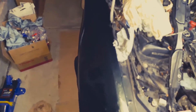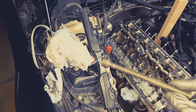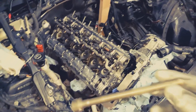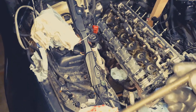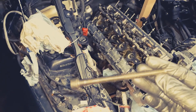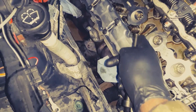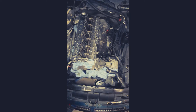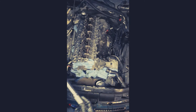Here are the new head bolts. I'm going to have to clean them up first before we install them. These are very easy to clean — just get a wire brush and brush out all the debris and get them real clean and nice. Then you put a little bit of grease on them. Also make sure you put in your washers first — there's no washer there, so I'm going to use the old washers from the old bolts.